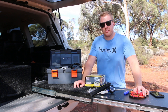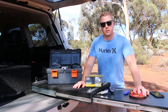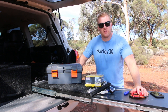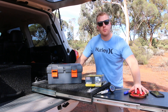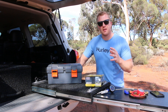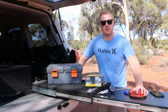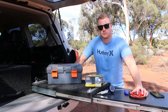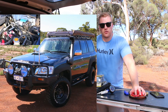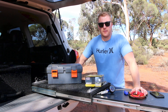The twin compressor we're using today is hard mounted into the side of a 200 Series Land Cruiser. For the last three four-wheel drives I've had, I've hard mounted the compressors in the engine bay. My preference is to have the compressors hard mounted somewhere inside the vehicle — it keeps them out of the way and stops boxes cluttering up your storage space. In addition, some of those vehicles had air lockers which do require the permanent fixture of an air compressor to supply the air locking mechanism.